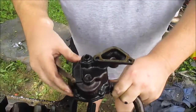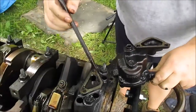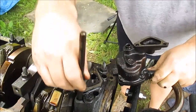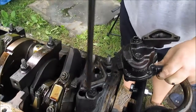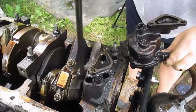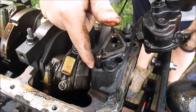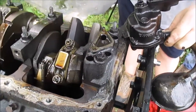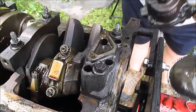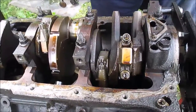This here is the oil pump - it should just fit in, it's keyed, and it goes down. It fits right in through this hole here. This goes and is driven off your cam gear. That's how you get the oil pump off. Taking the oil pump out gives you access to all the other caps.